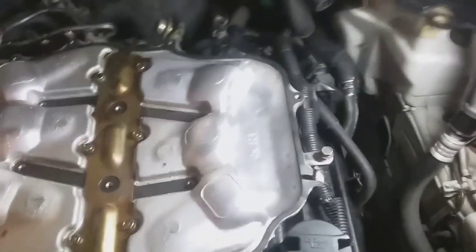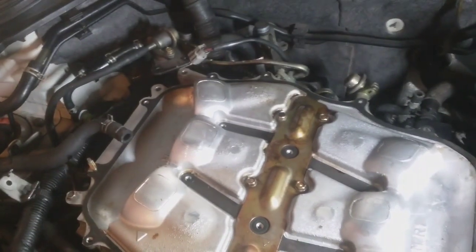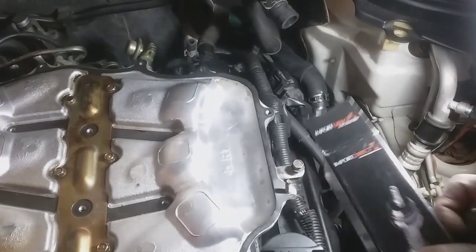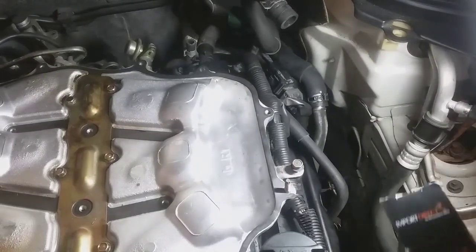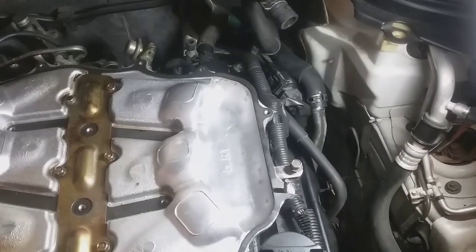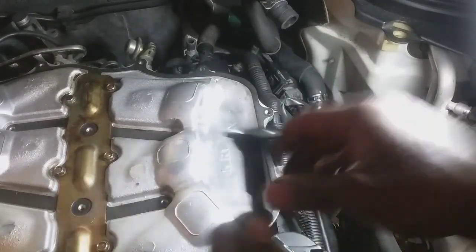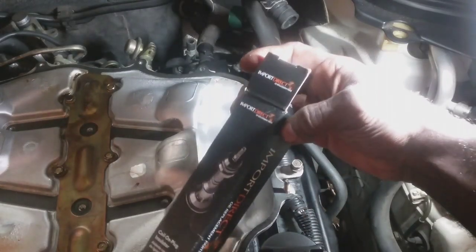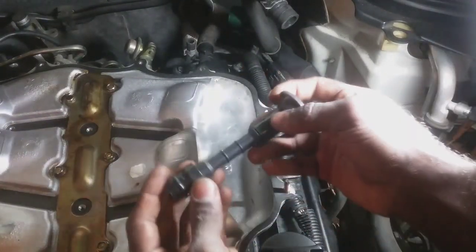All right, so the day is the next day. Got the valve covers replaced on both sides, and I don't know if I said, but if your intentions are to change the valve cover tube seals, you can't. They're integrated in the valve cover, so you have to change the whole valve cover. But here's the new part. So import direct part here, and here's the new part.